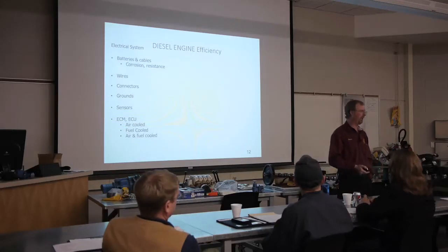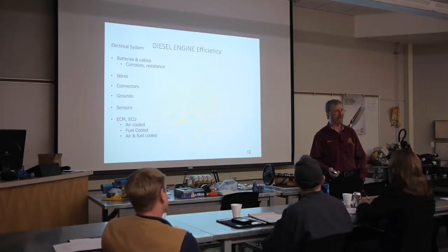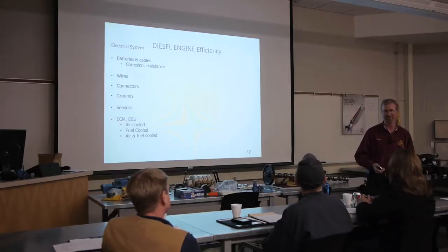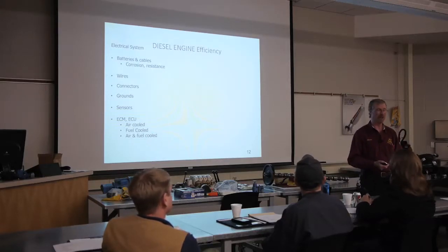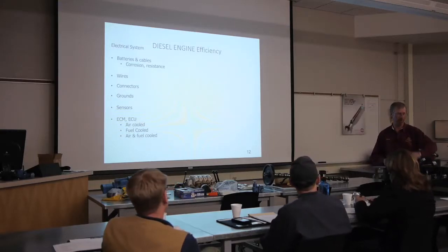If I completely toast a whole ECM, that is a piece of cake to diagnose. If I toast a diode or a transistor inside the ECM, oh boy, that ain't quite so easy to diagnose. That's really, really tough. When you diagnose, you're still going to replace the whole ECM, but it's going to take you a long time to get that figured out, all right? So keeping those things cool is very important.